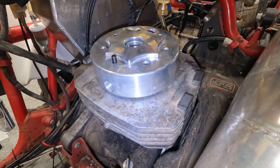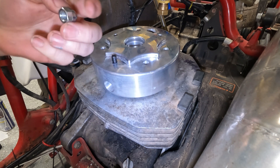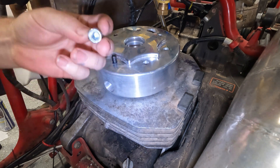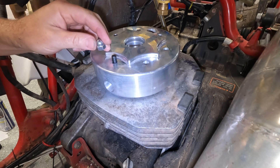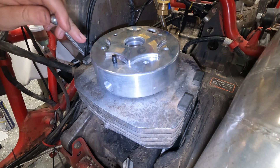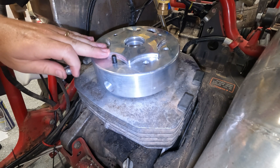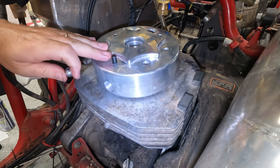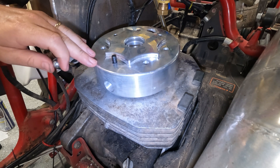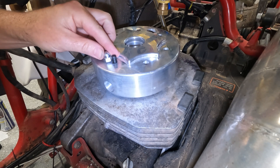Then you have the nut here. What you're doing is making sure that you have just enough space. Because this is threaded all the way through, you need to make sure there's enough space that when you tighten this down, you can actually torque it without hitting the top. I put the cylinder on without the head gasket — that's intentional, because that's just going to give me a little bit more space on this bolt. Once I put the gasket in, it's going to raise the head up slightly, giving me more threads to access.